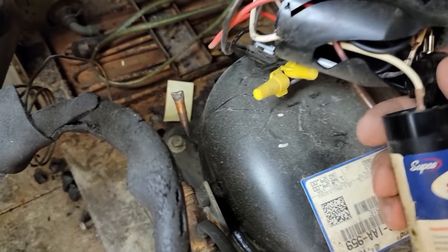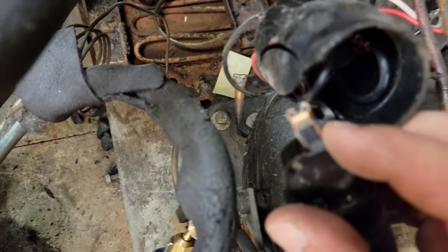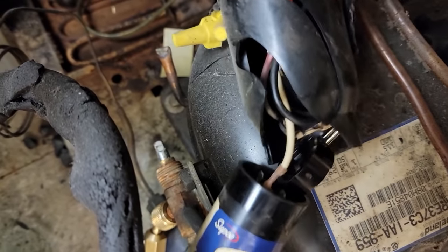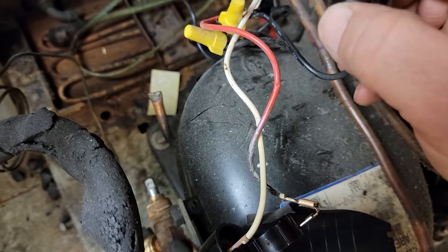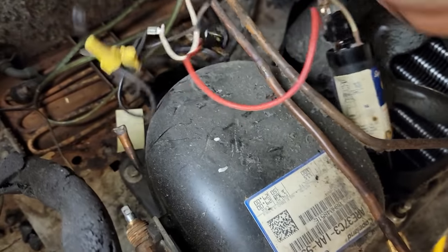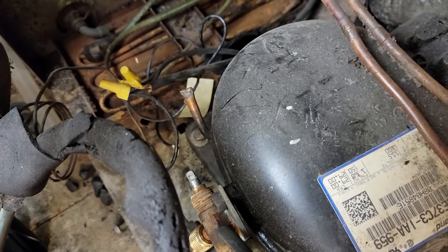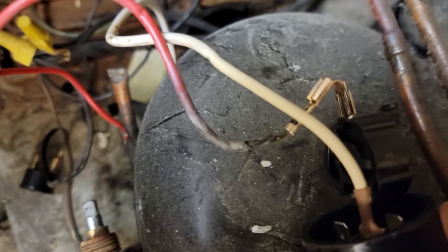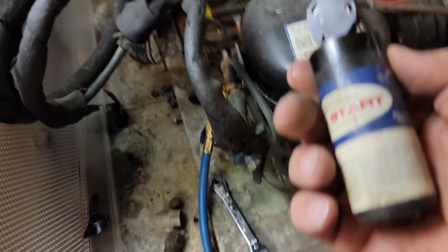There's your thermal disc. You can tell that puppy's been running hot. Thermal looks like it's been going off. What you got there is the thermal disc - that's your thermal for your common. That's if it gets too many amps it's going to shut it down. This right here is your capacitor, and it's got a PTC - positive temperature coefficient. You can see your wires right there. Chances are this thing is toasty - hopefully we'll get lucky and be able to throw another one of these on there and make this thing run another day.